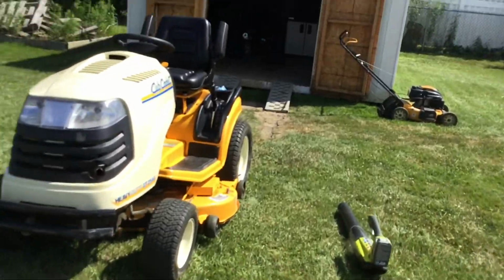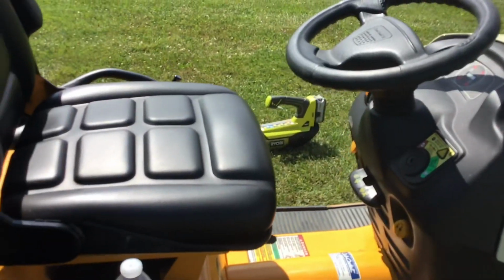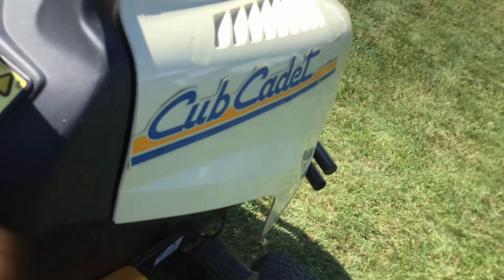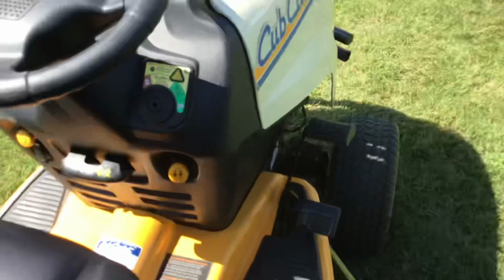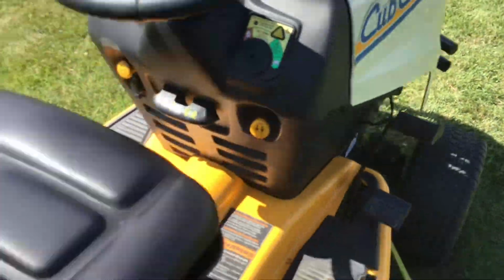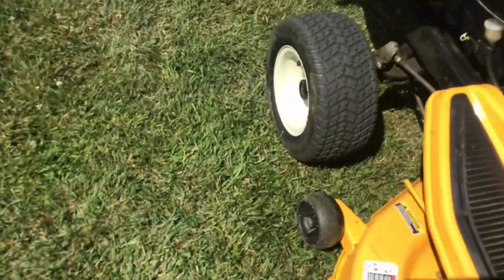That's the whole point of the oil sentry on the Command series of engines: if it senses low oil pressure or any issue due to oil, it will shut down the engine and/or send an idiot light back to the dashboard. If you have a real problem due to oil pressure, they should have an oil pressure gauge. And I would add one too, but this engine's never even been an issue due to oil pressure.